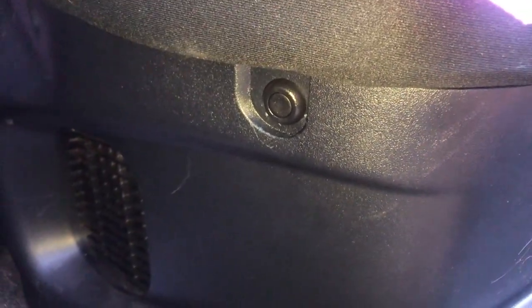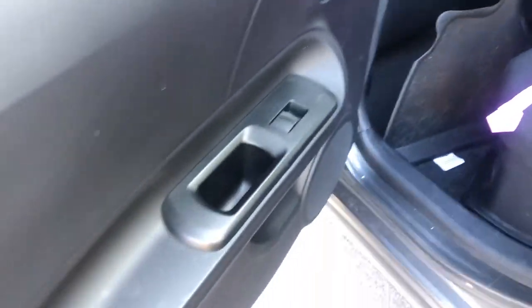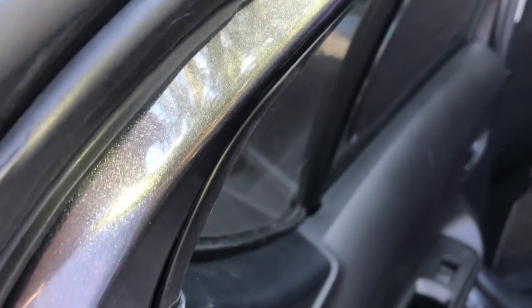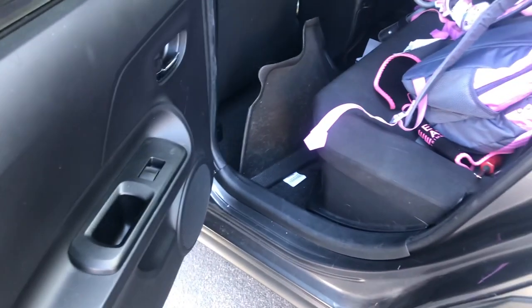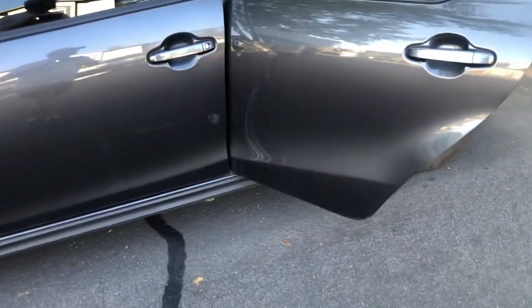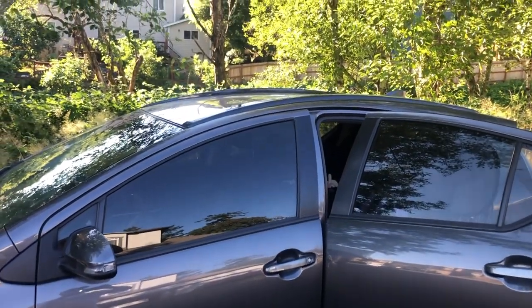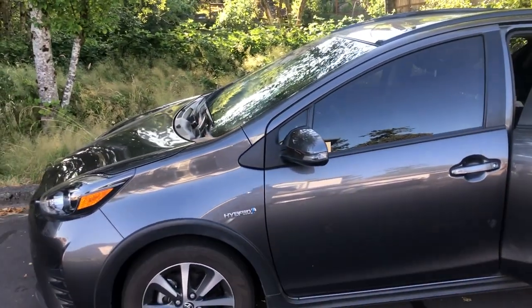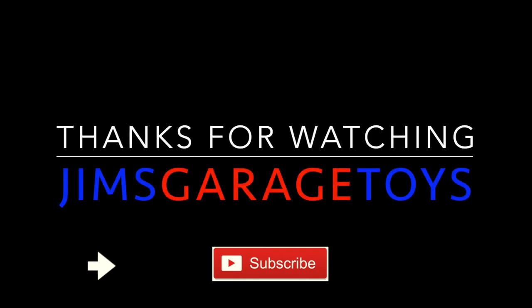This is the most important maintenance thing you can do on a hybrid — make sure you check this often enough and keep that fan filter clean, and the fan itself too. If you notice it's dirty, pull it out. That hybrid battery will stay much cooler if you can get air to it. Thanks for watching — I appreciate if you hit the subscribe and like button, and we'll see you on the next video. Take care. Bye.